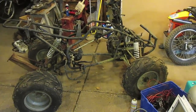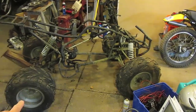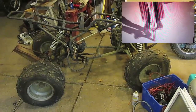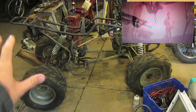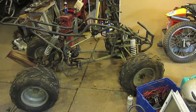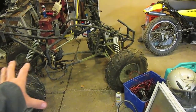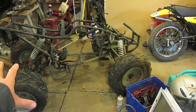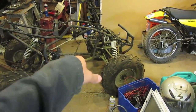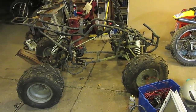This evening I'm going to eliminate the rear shock and weld it out to the frame, because the rear shock's been broken and pogoing for a long time. It really didn't work well for towing things either — it would lift and lower and do weird things. Front suspension is staying because it works well. It can't be any worse than a garden tractor — they have the rear wheels all tied to the frame, they don't articulate at all.